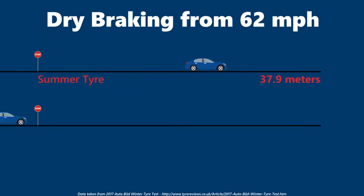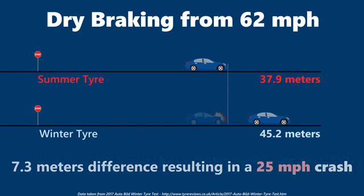Because these little cuts in tires called sipes are essential for snow and ice performance, the tire in the dry has a much harder time giving equal pressure of grip to the surface, and it's just got less rubber on the ground, so dry performance — especially braking — does suffer. Fortunately, premium manufacturers have got a lot better at mitigating this, so a modern all-season tire is very good in the dry, but not quite as good as a summer tire still, and the tire that's good in the dry isn't quite as good in snow and ice as the other all-season tires. It's a bit of a conundrum.